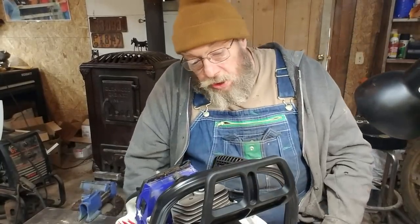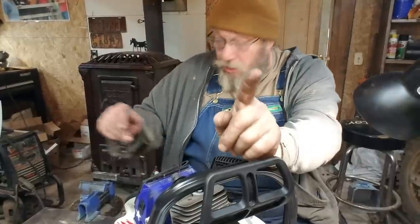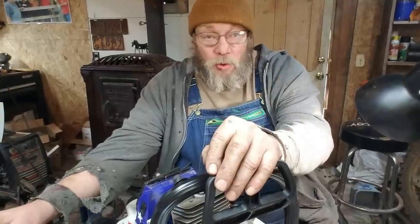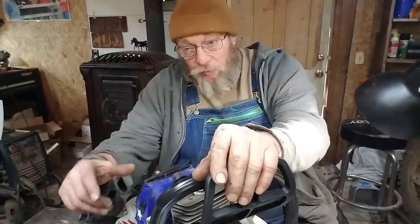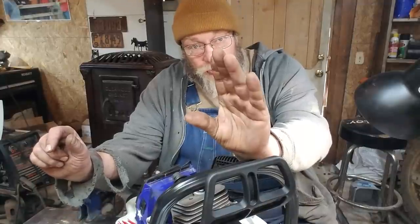I do want to get where this is kind of an automatic baffle, so it works like a power valve on a newer two-stroke. You guys know what those are, don't you? It's on the bikes. I'll explain it. It's a variable exhaust opening. What the power valve does, when you're at lower RPM, is close the exhaust down, and as your RPMs pick up, it raises it. It actually changes the exhaust timing.